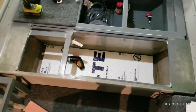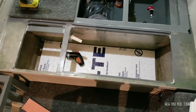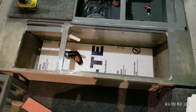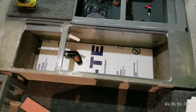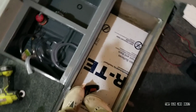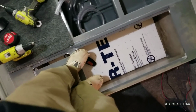There's this big misconception that you've got to cram the whole lumber aisle into your boat to make it structurally strong. As you can see, I've just framed this out with 1x2s, some L brackets, and some Gorilla Glue construction adhesive in the tube and caulk gun. And man, it's not about how much wood you put in, it's about how you actually do the framing process. I'm about 190 pounds, and this thing is jam up jelly tight. I'm standing on this and walking around, and this is before the decking even goes on it, and there's no issues whatsoever.